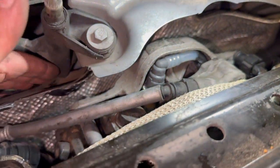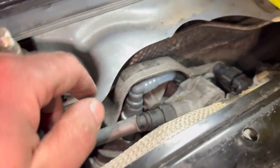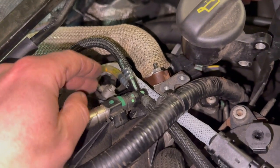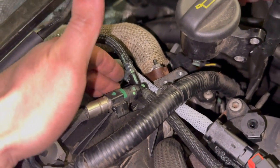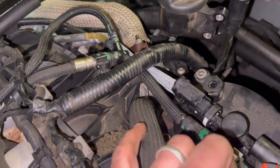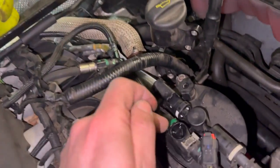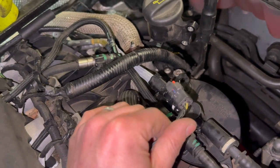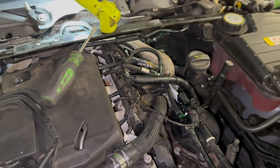The pipe's fitted now - I've nipped that side 8mm bolt up and just got to nip the other side back up. To get the pipe through it was a little bit tight, so I had to undo some of the fittings to get some of the rigid pipes out of the way to feed it through. I've left it disconnected a minute - I'll show you what the sensor reads when it's actually disconnected so you know what the default reading is on the temp sensor.